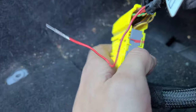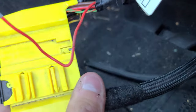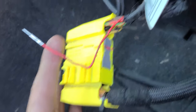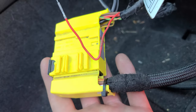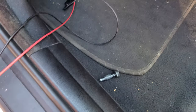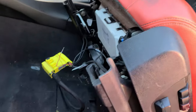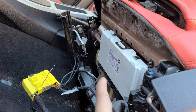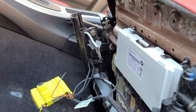The only wire I wasn't confident on - basically you have to remove this tab and you can slide each of these plugs out and then repin them. Put them back where I got them from, slid them all back where they were. They have little arrows on the actual cartridges. Leaving this one out till I confirm what it is and get a wiring diagram. For now we have our plugs in using the E90 harness - putting the key in, we do have power and adjustments, so this is actually usable. That is the F30 seat module.